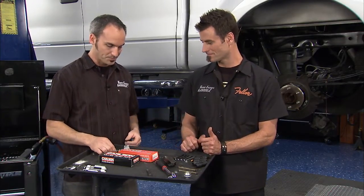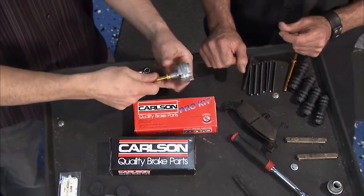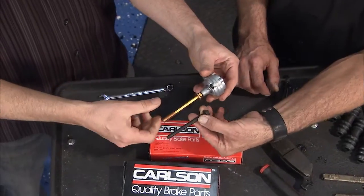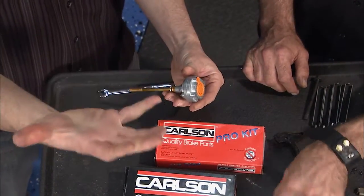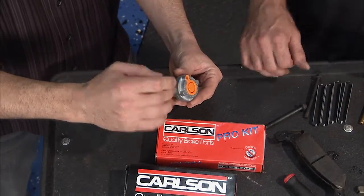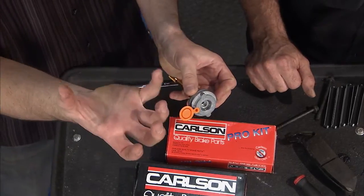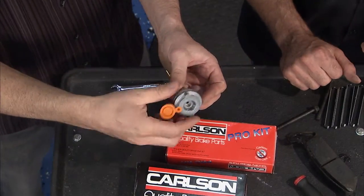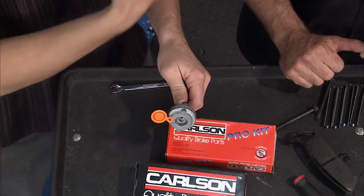There's not much you can do about it besides adding technology. This is a really cool bit — this is actually the caliper bolt. Here's the stock one we take out — it's got a stud end on it. And what this is, is a mass damper. There's a mass here, and inside — if you pull this cover off — you can see there's a silicone spring combination damper. This will vibrate at the right frequency, about 250 Hertz, and absorb those groaning frequencies.